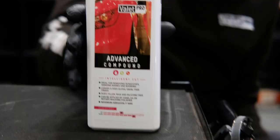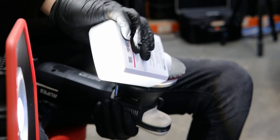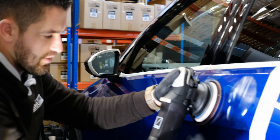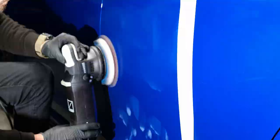Then four blobs. We're just going to spread it evenly. We're going to start off at a low speed just to spread our compound and then after that we're going to speed up and slow the movements of the polisher down for our cut. Now we're going to speed up the machine polisher and move slowly, and that's going to give us a cut.